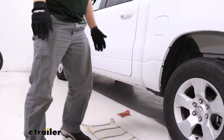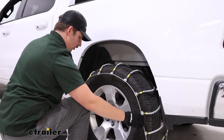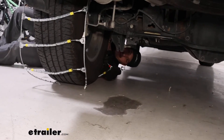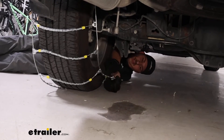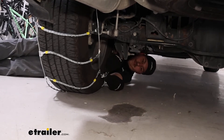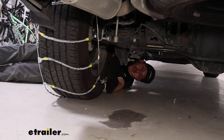Now with this all set up, we're just going to drape it over the tire, grabbing it in the middle, and setting it over the top. We're going to make sure it's relatively even side to side — right there is looking pretty good. We can make our first connection around the back. On the side closest to me we're going to have a catch plate, and on the side closest to you we'll have a series of studs. Basically you want to feed those studs through the catch plate. You want to do this probably in your driveway or garage once or twice to get a feel for it and see which stud you need to go to to get the correct fitment on your tire. I'm going to start right about there, going close to the end and hooking the excess onto these red hooks that are included on the cable.